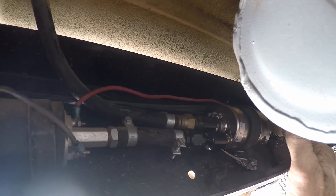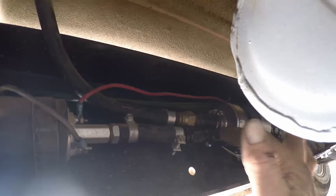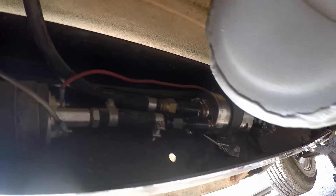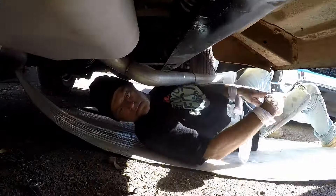Because we actually have an inline fuel filter already prior to the pump, we're not going to worry about another fuel filter. We mainly use these because they're regulated. We need to take all three of these lines off and reconfigure the fuel system a little bit for the fuel regulator, which is going to reside right there.